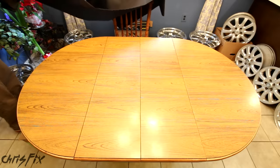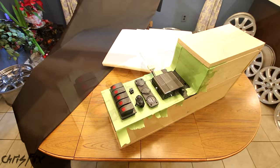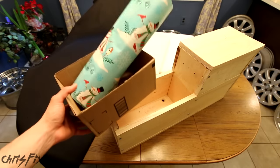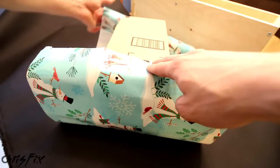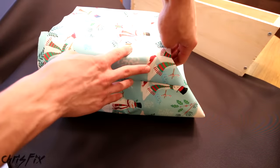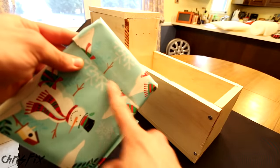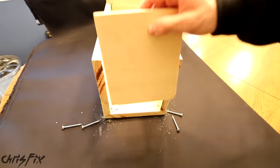For step four, you want to find a large workplace where you can lay out your material, your foam, and your custom center console. Next, we're going to remove all the switches and the black plastic, so we have just the bare wooden center console. Now when you wrap the foam and material around your console, you have to think about it as like wrapping a present. This box represents our center console. The first thing you have to think about when wrapping your center console is where to start and finish your material. Because with a present, you could just tape up over here and then fold in the edges. But with your center console, you can't just do that. You would either have to sew it, which would make it a lot more difficult, or find a way around that. So to combat our first problem, which will be the seam, we're going to take the front right here and completely remove it, and we'll wrap this separately.